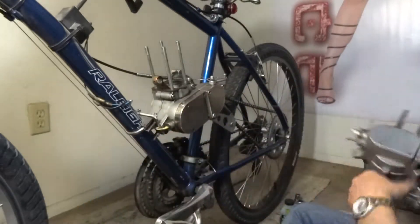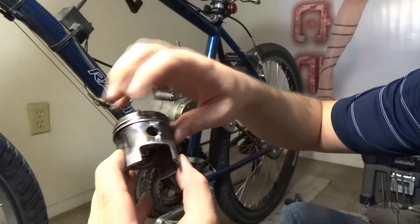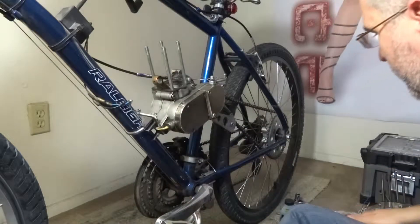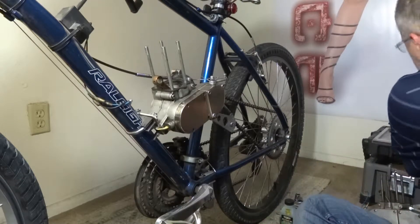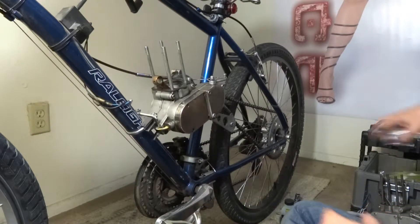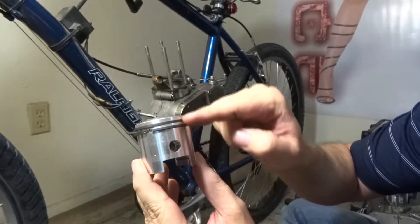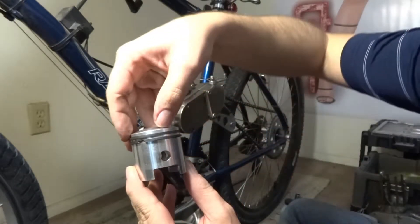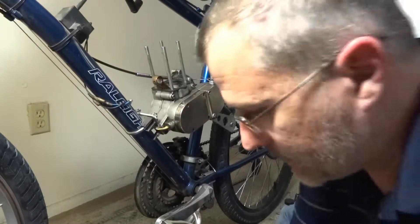The pistons look different. Here's the piston I'm replacing — what happened was the wrist pin bearings busted up as usual. This piston is for the shorter crank arm and it's got more space — 26 millimeters from the center to the top. So make sure you get the right piston.